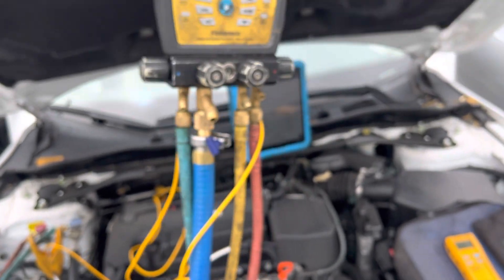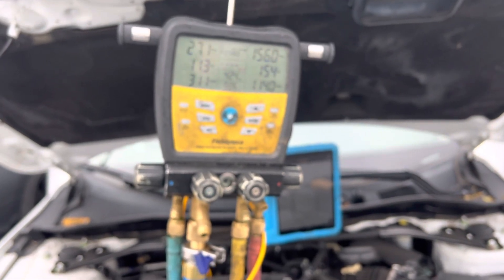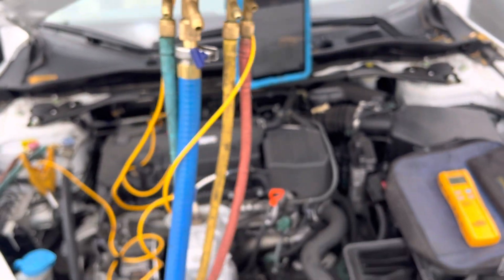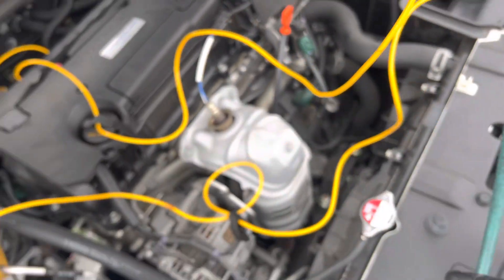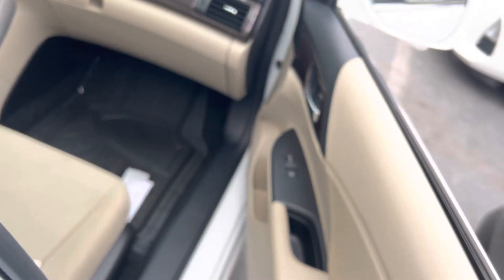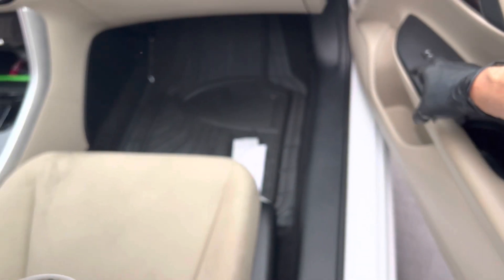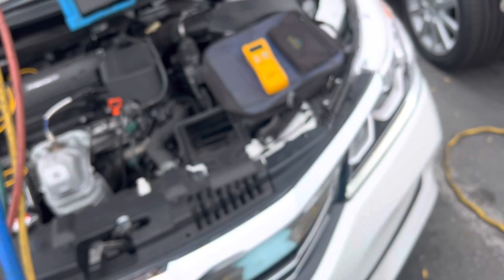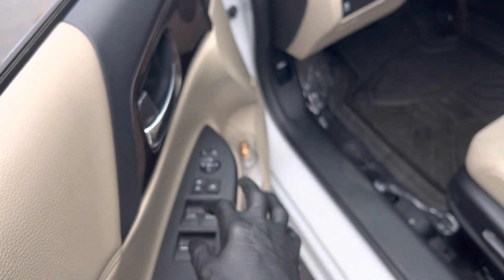As you can hear, you don't hear the clutch kicking on and off. If you look at the pressures, you don't see them raising and falling from the clutch kicking on and off. The fans are at a steady speed — both fans are operating at low speed. So right now I'm going to close the doors, roll up the windows, and this will force the car to get cooler. It'll meet its minimum temperature and then you'll hear it kick out the clutch on the compressor. You'll watch the pressures and temperatures change — you'll physically be able to see this particular clutch.